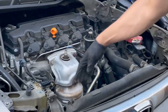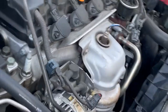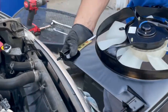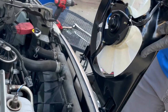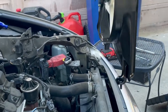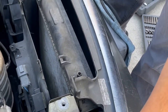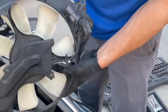The next step is to remove the fan. The way to remove it is there are two 10mm bolts — one here, one here — and it actually sits on two pins on the bottom. You can see the two pins; they basically go into a slot on the bottom, so they just kind of go down. Remove the two bolts and pull up. Be careful when you take this out — they do have washers, so make sure you don't lose those. Once you take those out, just pull straight out.